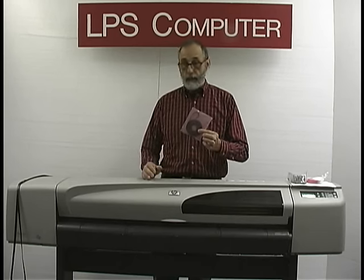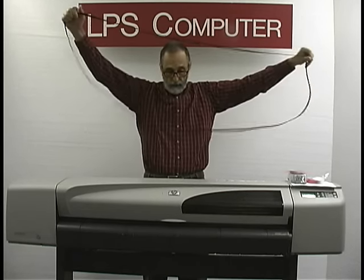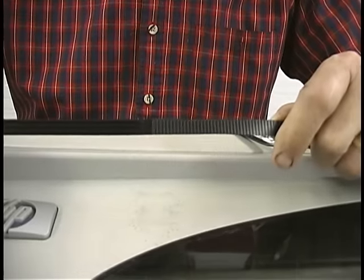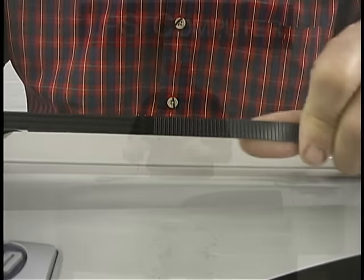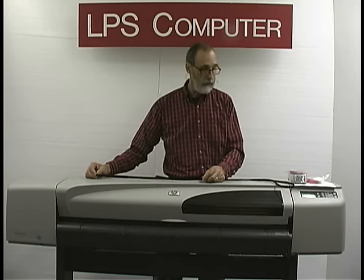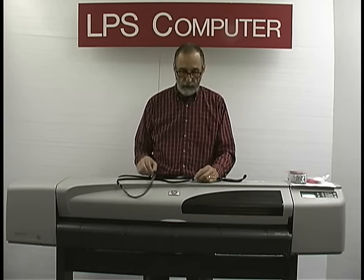The kit also includes a belt that comes packaged like this. The belt itself is made out of high-density polyurethane and Kevlar from DuPont. Half of the belt has teeth on one side and ribs on the other. The teeth go toward the motor pulley — which has teeth that drive the carriage back and forth — and the ribs ride in the idler pulley that keeps the belt centered. Belts coming out of Asia have teeth all the way around, so you can't use the OEM pulley and you lose that centering feature.